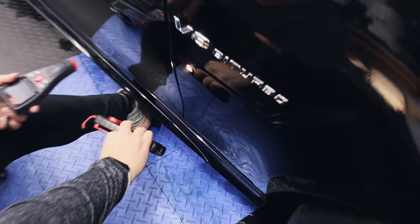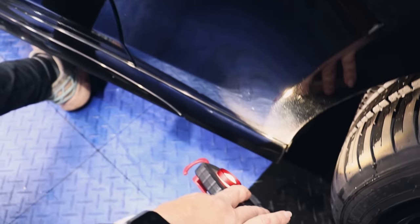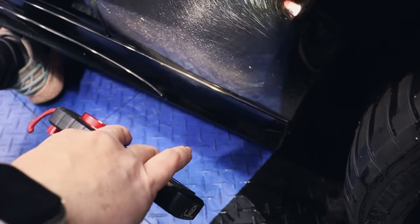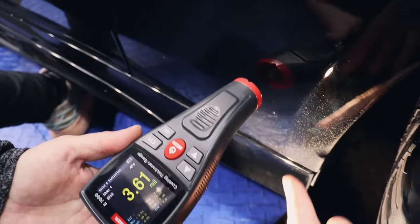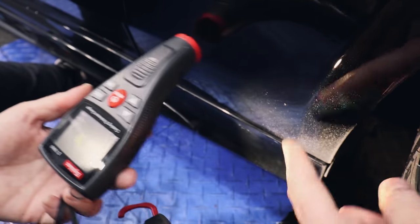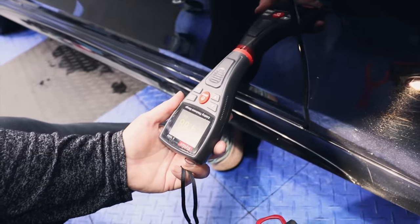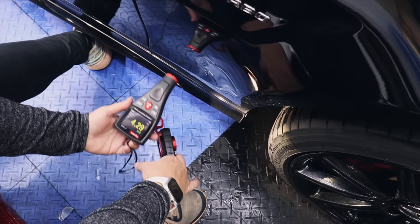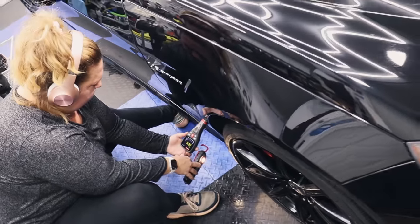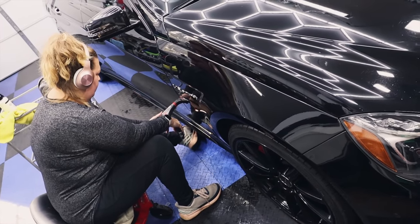So we're also noticing that down here, the road rash is really bad. So there's gonna be lots of pitting. Look at that. Yuck. It's to the point where it just needs to be repainted. We'll gloss it up, it'll look better, but. Ooh, that is low. Yep. So we gotta be careful around here. That's not too bad. We can maybe do like one cutting and then that's it. It's gonna be thin in some areas, but overall, I think we can do one, maybe two cuts and call it a day on that. Or maybe just one cut and then we'll polish it.